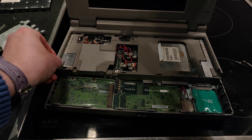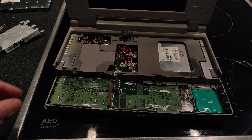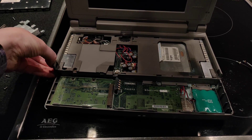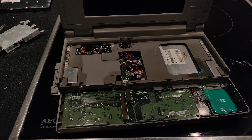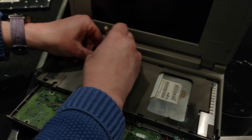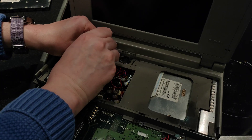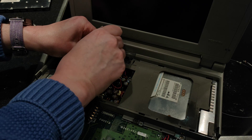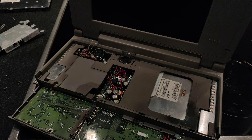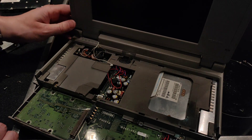There are definitely screws in the top cover so they must come out — please God let them come out. This is why it's saying to support the screen — it's a bit back heavy now. It says there are six latches securing things — I think we can take that as clips. If I can use some of these mobile phone tools to help me unclip stuff. It says there's a sensor, and the posh version would have a microphone as well as the display cable, but we do not have the posh version — though that does leave open the question of whether you could fit a mic if the slot's there on the motherboard. That sensor is probably the one that tells if the lid's closed.